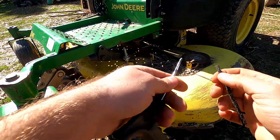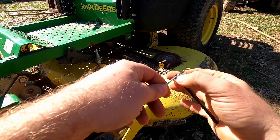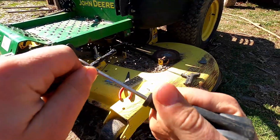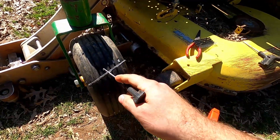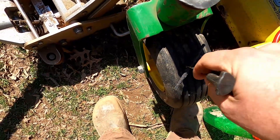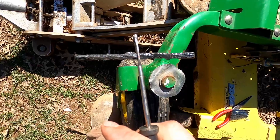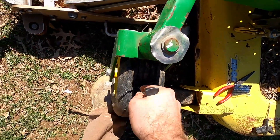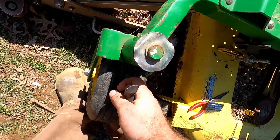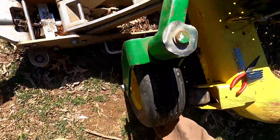What we have to do now is put the plug through the tool — it's like threading the needle. I usually just swish one end of it, start pushing it through, grab it from the other end, and pull it. Sometimes they recommend putting rubber cement on it to help it seal, but I usually just stick it right in there. Find the hole, make sure it's about halfway inside the tool, then push it straight on down in there. You want to push it in a good ways so there's just a little bit sticking out, then pull the tool out and it'll just stick right in there.